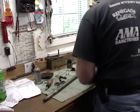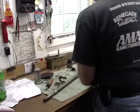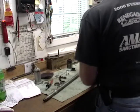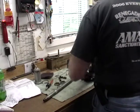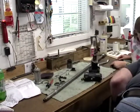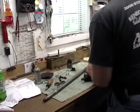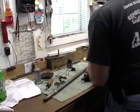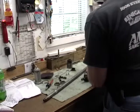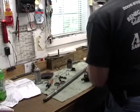That is a pitman arm. Is it a handle? No, sort of. It goes right there on the end of that section. It goes on the end of this. That's what makes it work. When this thing turns, that thing swings back and forth like this and pulls on this linkage right here. It causes it to go back and forth. And that makes the wheels spin? It makes the wheels turn, not spin. That's how you turn a car. Left and right. Left to right. We'll show you when we get into here a little deeper.